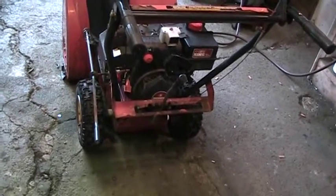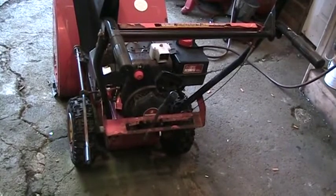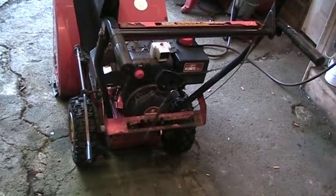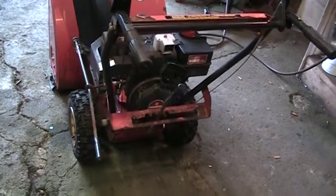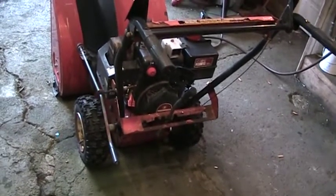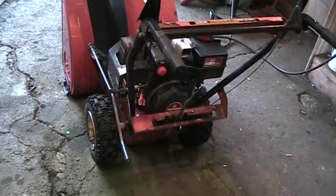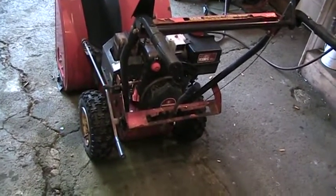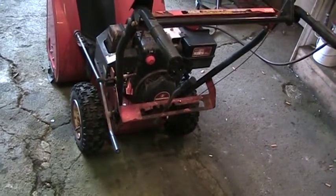We're going to drain the oil. I did have it run in there for a little bit to warm up the engine. I want to dump all that old oil out of there and put some fresh in there and take her step by step. We're going to pull the carb off and do all that fancy stuff and get it in the drive. Make sure that's all tuned up, ready to go. Check the friction wheel, chains, lube everything in there, and get it ready. Alright, hold tight. We'll get you in the stand and carry on.